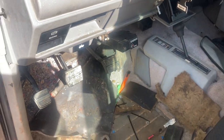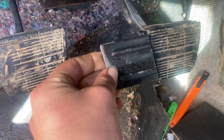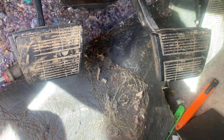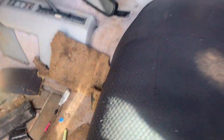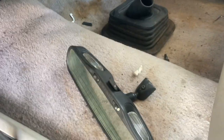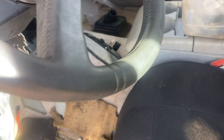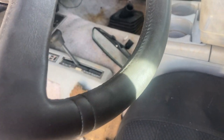There you can see the two studs and that square hole in the middle. The only other thing I had to do with the pedals is I cut down the brake pedal a little bit — I had to cut that much off of it right there — and there's the original cover for the brake pedal. These trucks already come with, underneath the carpet, a square outline for the shifter hole, so all you have to do is follow that outline and cut it out.